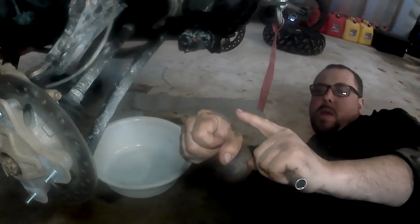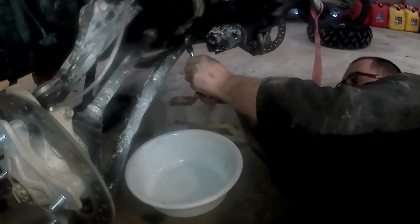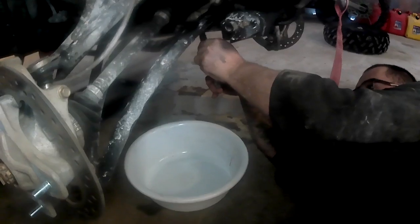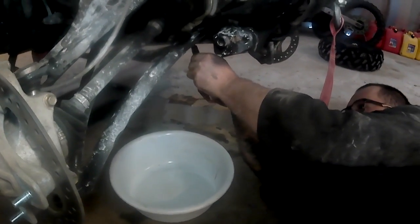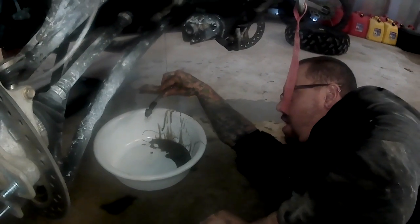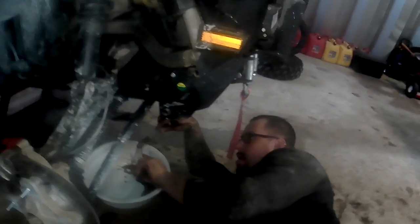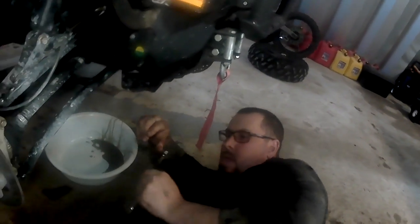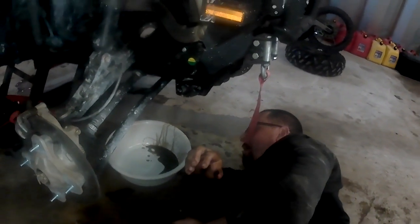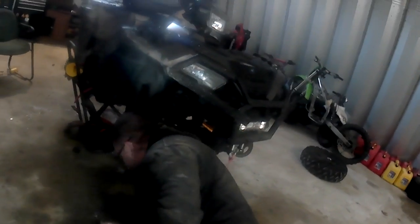It's thin — yeah, it's water. Although this oil is clear, it's not purple when it goes in. And it drains. Yeah, she's got water. Actually, it's not horrible, but it's got water. Any filings on that plug? No, none. Well, she's good. Good thing was, that was a full ride. These differentials don't hold much oil at all.